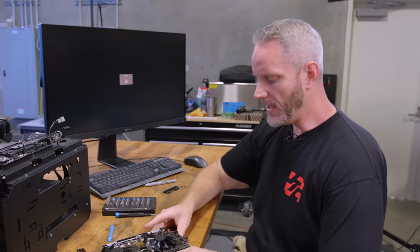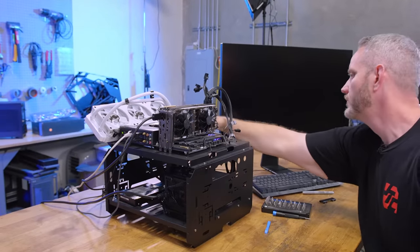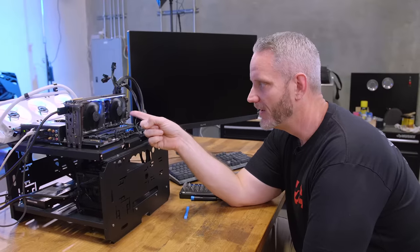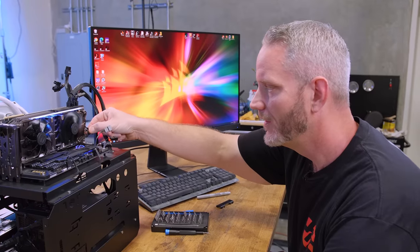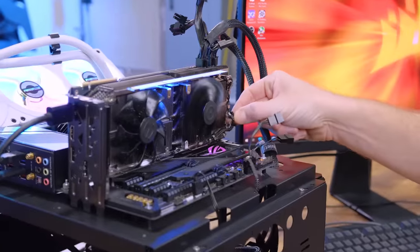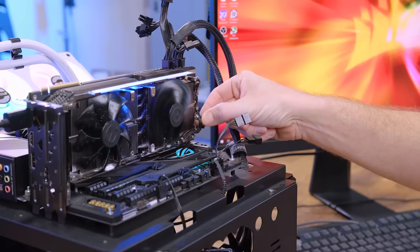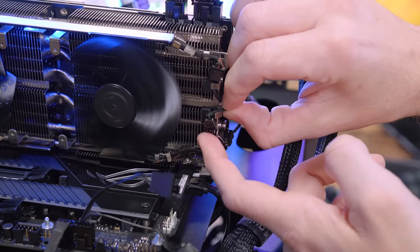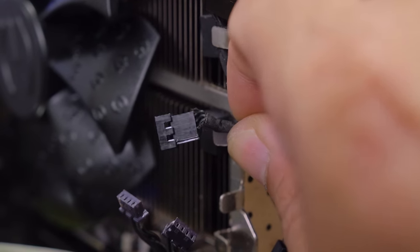After switching them back — it's the same behavior as before. So the 100% behavior follows the same physical connector, not the header. That means all I did was unplug and reseat the connector, and something about that fixed it temporarily — possibly a loose connection or a wire being pinched in the metal bracket tabs. I'm thinking it has to be a cable or broken wire issue. I want to inspect it more closely.